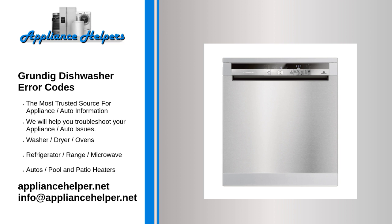999: Possible leak detected on models with floor protect with alert feature. For all other models, the unit's control needs to be reset. Dishwasher floor protect is a leak protection feature — the dishwasher will not start; contact service. For all others, reset the control when the 999 error code appears in the display.